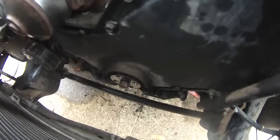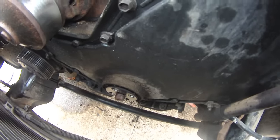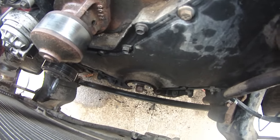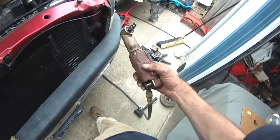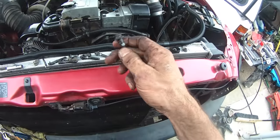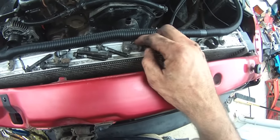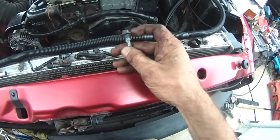That went a little easier than I thought it would. The harmonic balancer came right off — all four bolts came out. They were tight but they didn't fight me too bad. It was a little juicy back there, but I've got a new seal from Cummins. Let's pull this cover and see what we can find. Looks like they used a heaping helping of gray RTV silicone. There's no thread lock or anything on these threads.